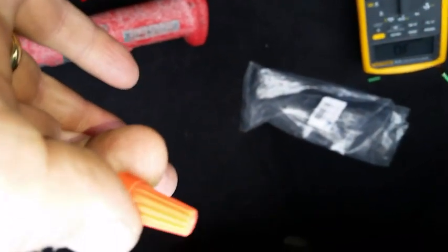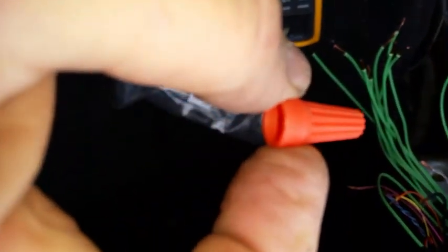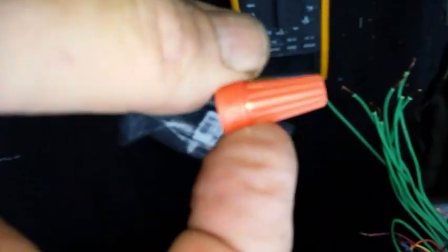And whatever, which one of these green wires is that connection. And the others will be the light orange. Those will be for the 20, 18, 16, or 14 gauge wires that bond to those 12s. I'll use these. They're good for, I think there's a chart, but one 12 gauge and a small wire together, these are the good size to use.